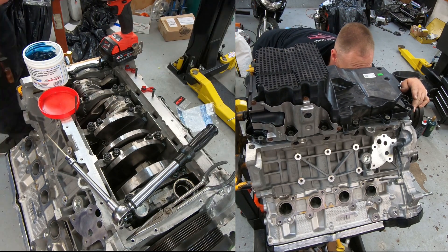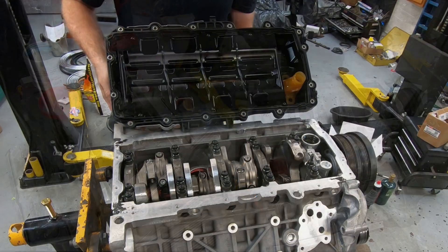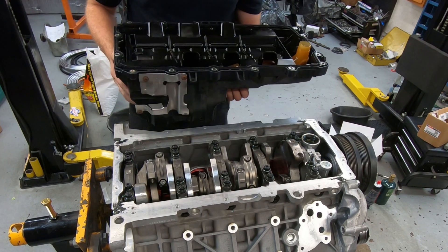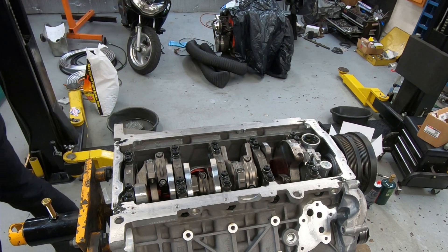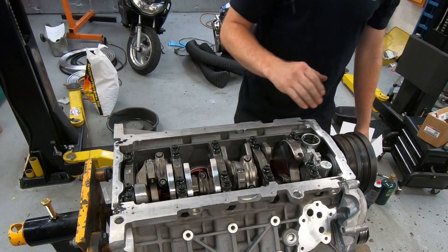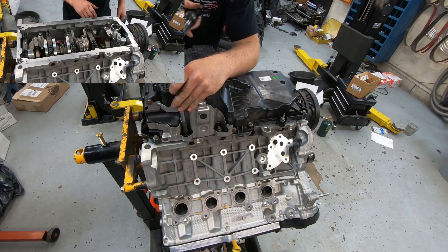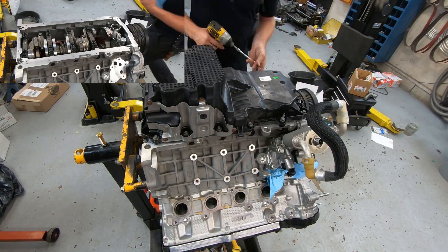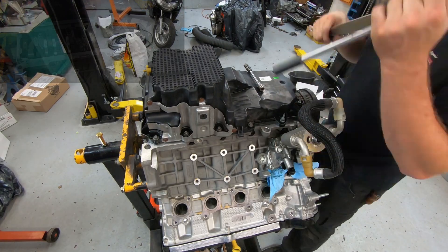It's hitting the plastic still — that thing is annoying. It's hitting right here and it just does not work well with this motor. I'm going to take it out, move it over, grab a saw, cut the end of it off, put it back on, and be done with it because it's in the way. Enough is enough. I've also got to clean off this RTV now because it's going to dry, and I can't have RTV curing before I get the pan on here.